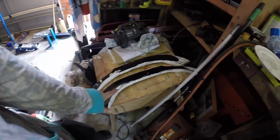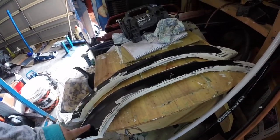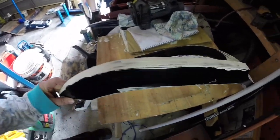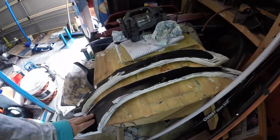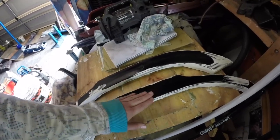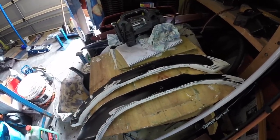So here we've got some wide ones — about twice as thick as OEM. These are pretty much two of the flares together, just a tad wider. What we're gonna do is clean these up, make them nice and smooth, seal them in with some floor varnish so when we do the mould it doesn't grab onto the paint or the filler, and we can start producing these.